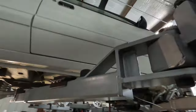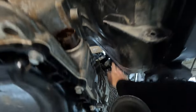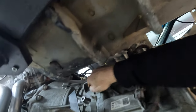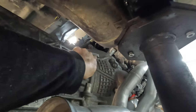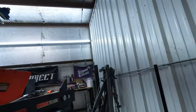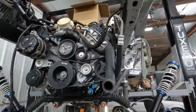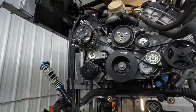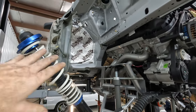The motor sort of dropped down out of the car — now we can get the cut-off wheel in here a little bit. Heat it up and maybe take that off on this side too — a little bit off this. We don't need to do that but we can — might as well make things easier. As you can see, we ground this off. We took some off this tab and some right here, but we're getting really close in the tunnel. We also took out the quarter-inch spacers that were in the motor mounts — we don't think they're necessary and we had the clearance. So while we're up there, I'm going to grab the transmission harness and run it along the top of the transmission to make our lives easier — and that'll be done and out of the way.